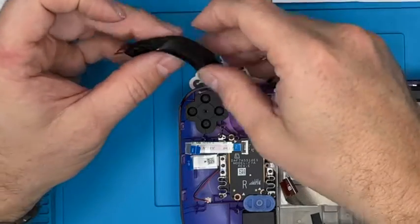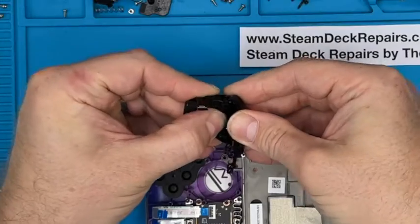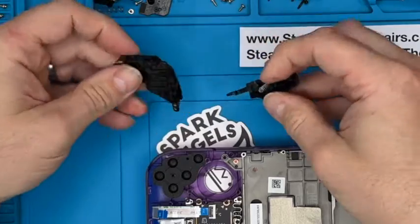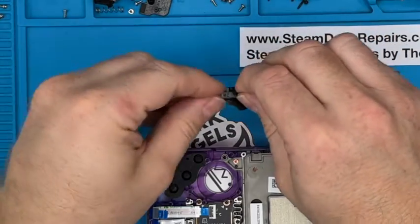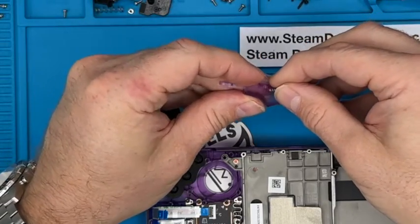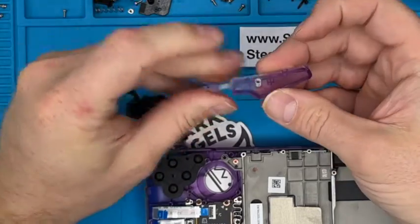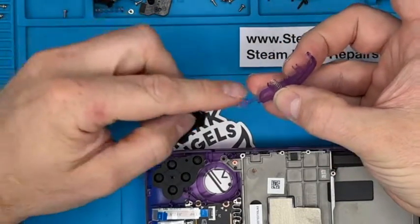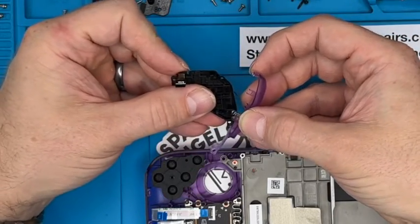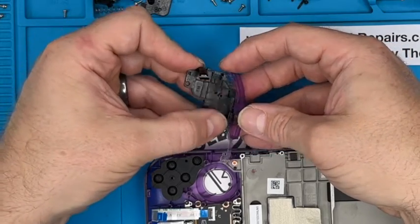Put the rubber in. We're going to change this bumper out, so we just literally pull the tang out that end, like so. Comes away. We recycle the spring, pop the spring in onto that little spigot that pops out, and again lead with this end in first. So I start with that on the spring bucket, so I clip it in round the edge of the spring, or the spring in first, clip that round around the edge side of its bucket.